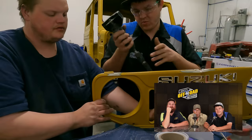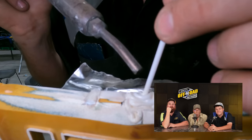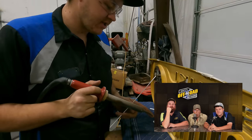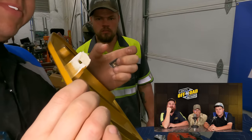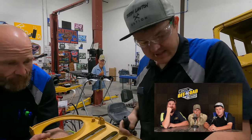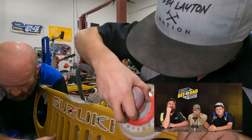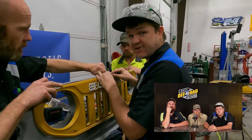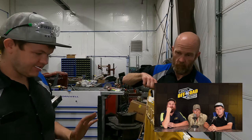So I'm cutting the cracks so I can weld them back up. Now we're building it up with round rod, flatten her out, rebuilding this lower tab. We've got rod in there, now we're going to form it. Cool that down to where it's rigid — it's all one piece now. Can't even tell it was broken. These are the last of the cracks — we've got three. Weld them up, melt it all together. Crack is fixed. Thank you to the viewer that sent it to us.